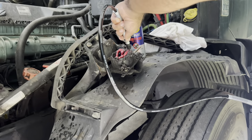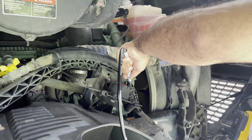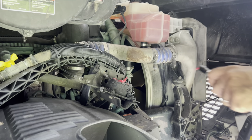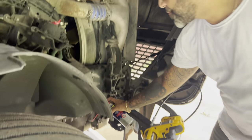Freightliners don't have these — they got the latches, but Volvos do. If you don't keep those greased, they will break on you. One of them went bad on me from not greasing it. I think it cost me like $200 — I changed both of them, it was like two hundred and change. So you want to keep that in mind. Grease points — clean them.